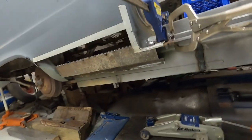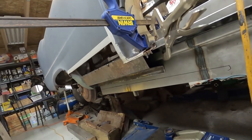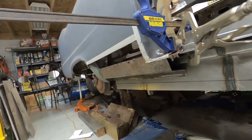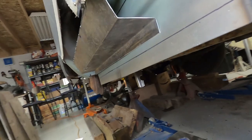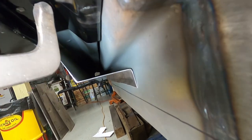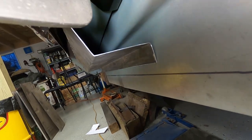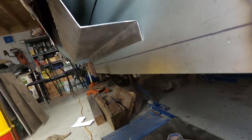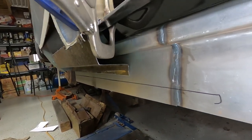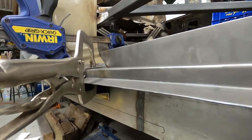When we tacked all this 18-gauge metal on here, I'm going to try to get a shop light here and show you guys a little bit about what we did inside there. If you look inside here, you'll see it's all primed in there — we primed all that inside. It's nice and clean, no rust going on there. There's primer right where the two pieces of metal are going to touch each other — etching primer on that.